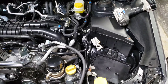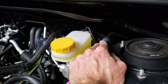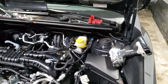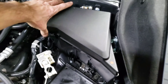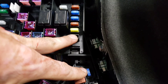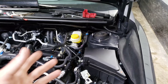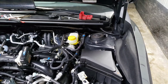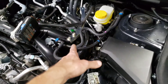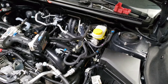I have the battery out now. The next thing I've got to do is the fuel feed line. It's just going to be a flathead. Make sure you have a towel or something because some fuel is probably going to drip out. I did go ahead first and pulled the fuse for the fuel pump — that's going to be your 15 amp fuse right there underneath the 20 amp. Go ahead, pull that out, then start the car up. Let it run until it dies. It literally sat here for like 10, 15 minutes before the fuel cut out and it died. So the fuel pressure is killed out now, so we can go ahead and take this off. Do not try to take this line off with the fuel pressure still primed — just not a good idea.